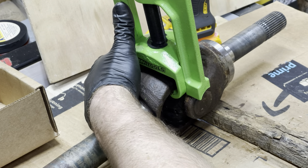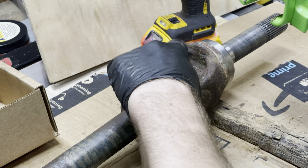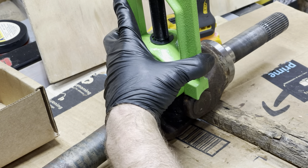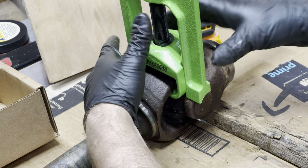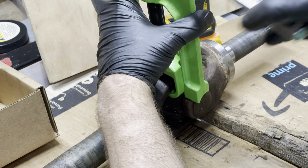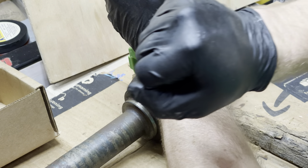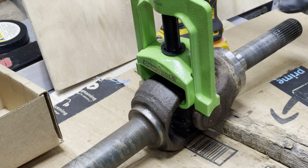I also bought the smaller version, which I had some limited success with. The way this works: I've already pulled one of the caps off, but if the cap were there it works the same — get this loosened up, stick it under here, line this up as directly above that u-joint as you can so you're pulling in a straight plane and not jamming anything. Get her snugged down by hand, then just start cranking. You may need an impact gun — these are rated for impact wrenches if it doesn't come by hand.